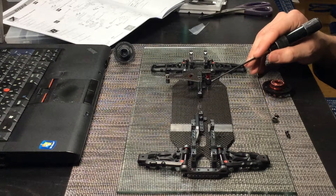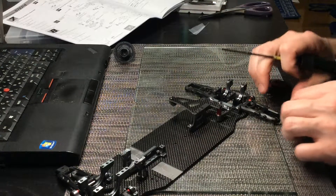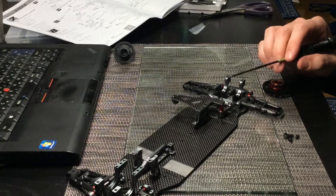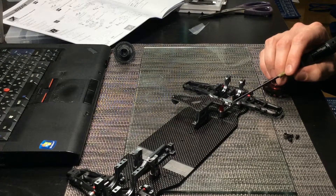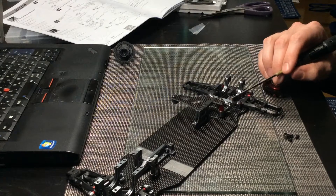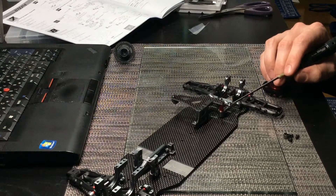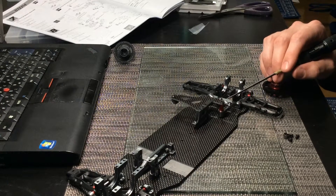One thing is there are certain points in the steering system that I noticed had a little bit of slop, which I took out quite easily by adding a few shims. I noticed the points where the steering bridge connects with the steering arms had some slop, and what I did is I added some washers.